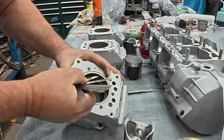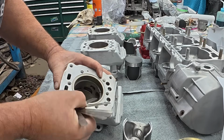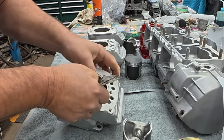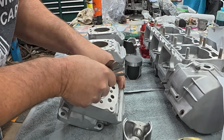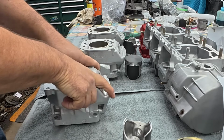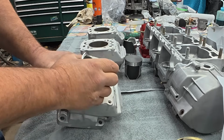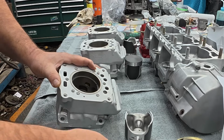I'm just trying to fit it in the gap there. Oh yeah, tons of room on the 12 thousandths. We'll jump up to the 18 and see if that fits or not. The 18 has some slight drag there, and I knocked my ring loop out of square. So I'm just using the piston to square it up. So back to that 18.